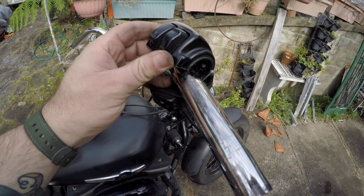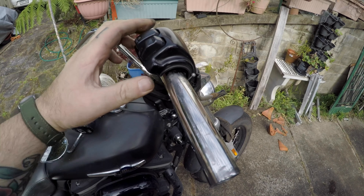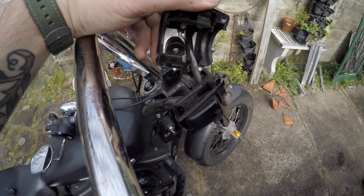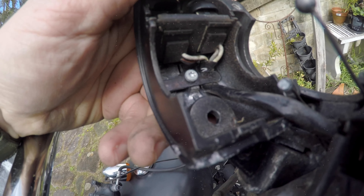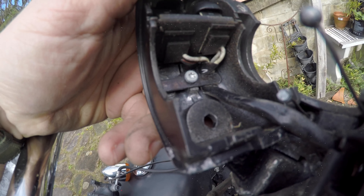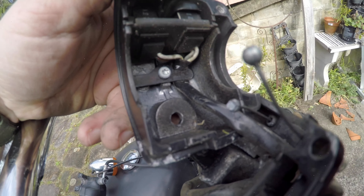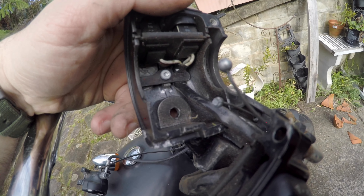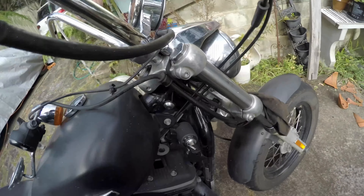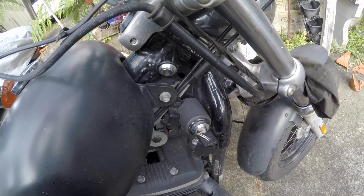In case you're wondering if you could make life easier by just removing the switch blocks without removing the petrol tank - the reality is you can't, because all the wires are mounted into each switch using rubber grommets, it's all sealed and epoxied in. There's no chance of removing the switches from this side. You're going to have to remove the petrol tank, or at least raise it, and unplug the switches from underneath on the opposite side of the bike.